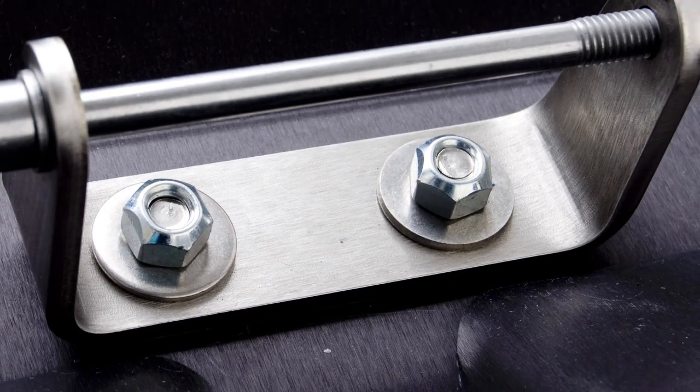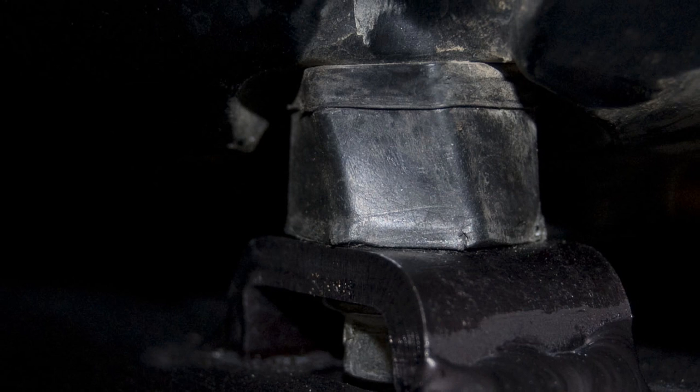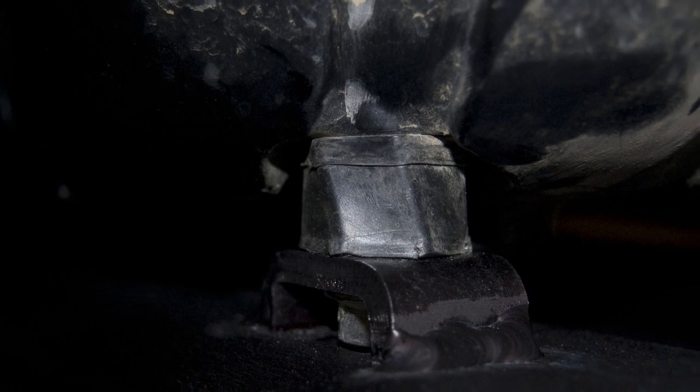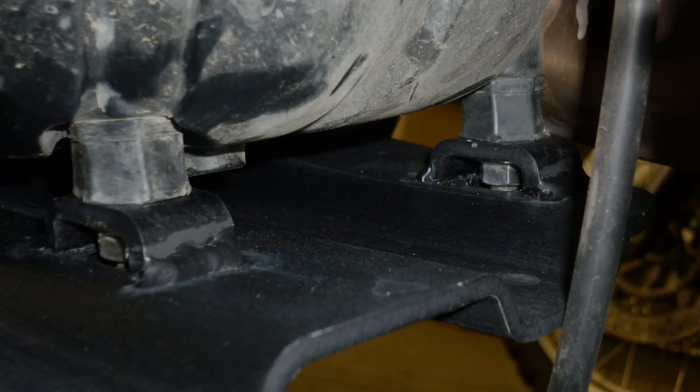After multiple big hits, alignment can get a little iffy. In your pre-ride inspection, if you notice that your vibe ISO mounts are deformed, you should take corrective action as critical failure can occur if left in that position. Remove the skid plate, reposition so that the mounts are not strained, and reinstall.